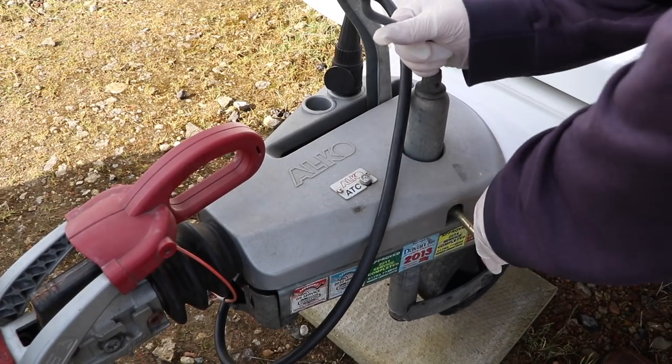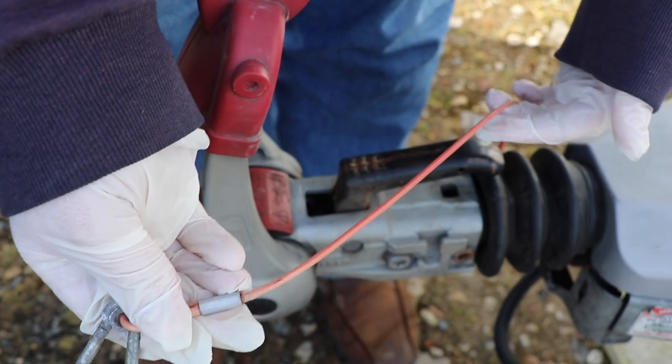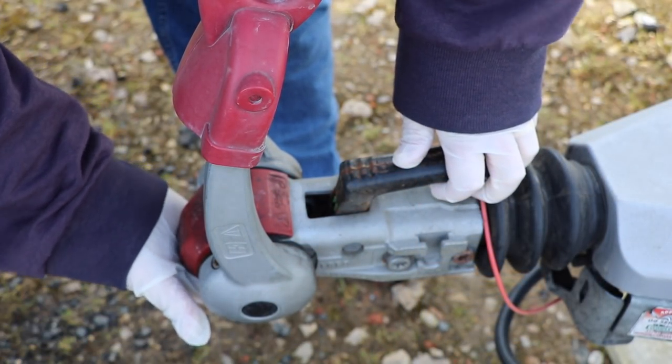Hopefully when you parked up for the winter you covered your hitch to reduce moisture getting in and spoiling the components at the front. Start with a good visual check to make sure nothing looks broken, and pay specific attention to the breakaway cable — make sure nothing is frayed or broken and the cable is in good working order. If it's broken, frayed or looks damaged it will need replacing; it's a legal requirement. For the hitch head itself, many caravans today come with stabilizers — feel around the friction pads, make sure there's no grease, grime or contaminants. If they feel shiny or have deposits on them, pop them out, clean them up and put them back in.